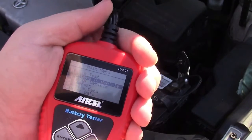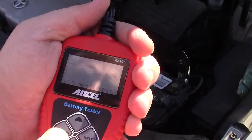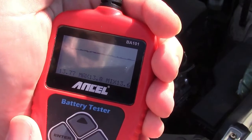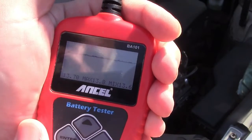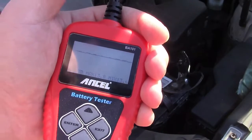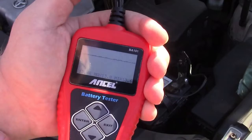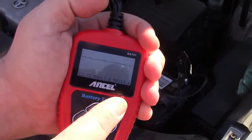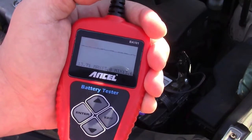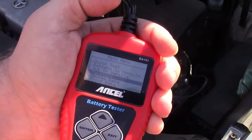That's really all there is to it. We'll go to waveform, and now you can see a graph showing little ripples here and there. That is showing the small anomalies in the charging, because although the engine sounds like it's running smooth, it does not run at a perfectly straight RPM. It might be running at around 700 RPM, but it's not exactly 700 — it might be 695, 705, 693, 708, up and down a little bit like that, so you get stuff like that in the waveform. Press exit and you're out of there.